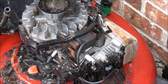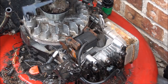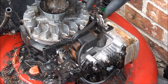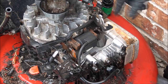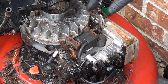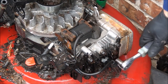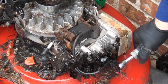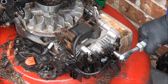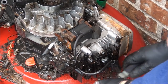This is what this setup looks like. You have this little actuator which operates your choke. When it's cold the choke will always be in the on position, but once the engine heats up this little thing moves and opens the choke — heat operated, believe it or not. Since I'm here I'm just going to put a half inch socket on these head bolts and make sure none of them have loosened up. This is the one that usually loosens up, but it feels like it's still pretty tight. You don't want to over tighten it, but I usually just put a wrench on it to see if it has loosened up at all.